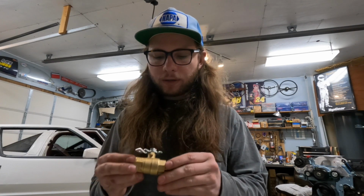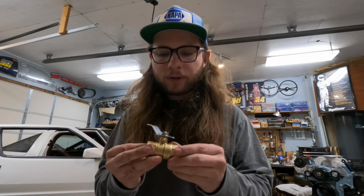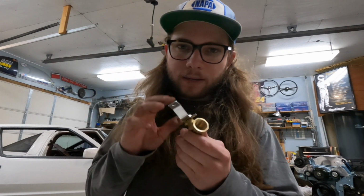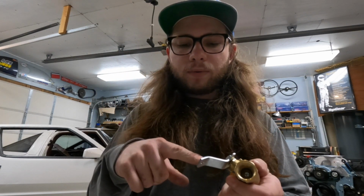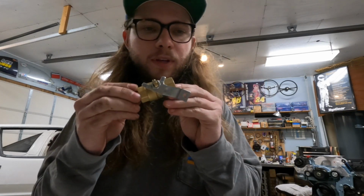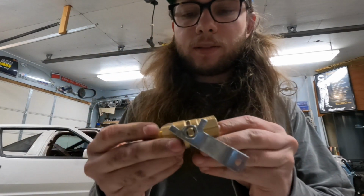So it's going along pretty well with mounting the AccuSump valve assembly that's going to control turning it on and off. Elder Guru came in and explained geometry to me. Since this valve operates at about 90 degrees, what you need is a throw that doesn't go 90 to 90. You need one that goes 45 to 45 from the point of start. He drew me a visual that makes sense.